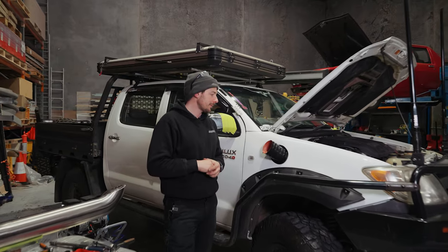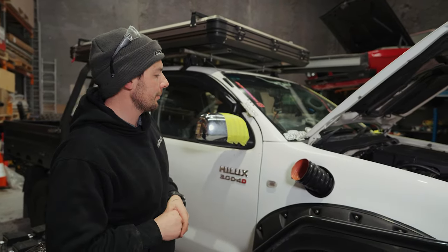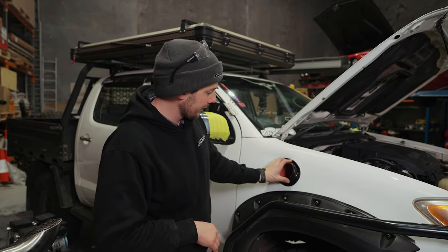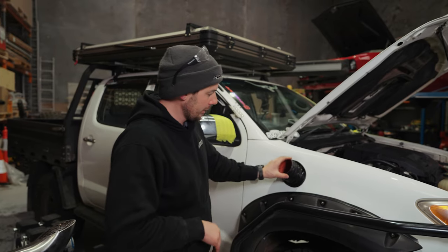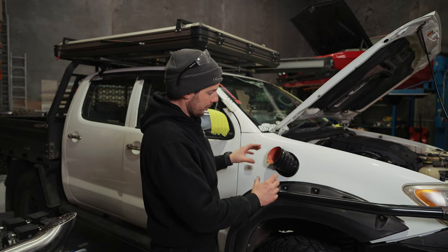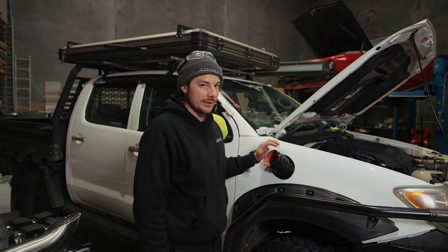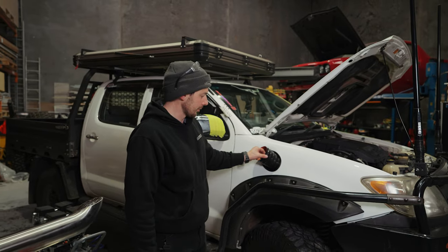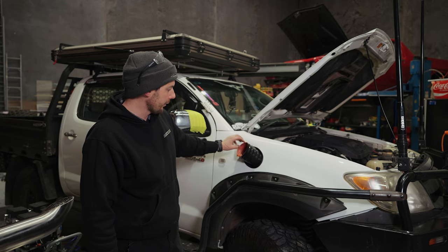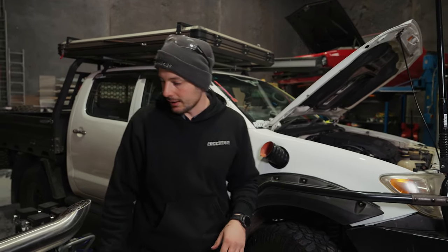All right, so we're coming up to the final stage. We've taken the tape off the guard and upside the pillar. You've got just a little bit of hose hanging out. This is enough to actually push in with the snorkel. If you're using one of our hard kits, you'll be putting the snorkel in and connecting that up once it's in the guard. So this is a lot easier and still just as good as the hard kit. So the next step is we'll be placing the 4-inch adapter into here, and then tightening it with our 4-inch band.